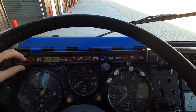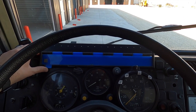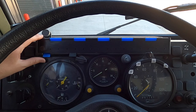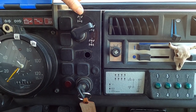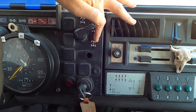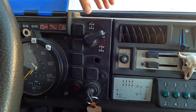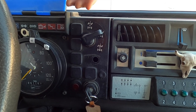When these warning lights are on while driving at night, you can fold down a cover to help dim them, and there's a second position with tiny holes that lets just a little bit of light through. Here's the four-wheel drive selector: this position is two-wheel drive, this is four-wheel drive, and this is four-wheel drive with dual lockers. When you engage four-wheel drive with dual lockers, the Unimog actually sends air pressure into the drivetrain. The drivetrain on a Unimog is completely sealed — drive shaft, axles, portal axles.